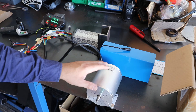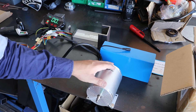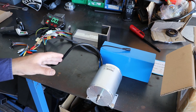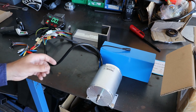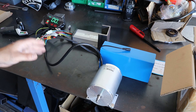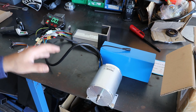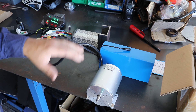So you don't need to worry too much about the battery. The most important thing will probably be capacity - 15 amp hours is probably the minimum if you're going to have a scooter that you want to get maybe 35 to 40 kilometers out of as far as distance goes, and still have enough power. Anything less than 15 amp hours I'd probably say is too low. The scooter we're making is going to be made out of steel, so there will be extra weight as well. Just have a think about how far you want to go before you go to a cheaper battery.